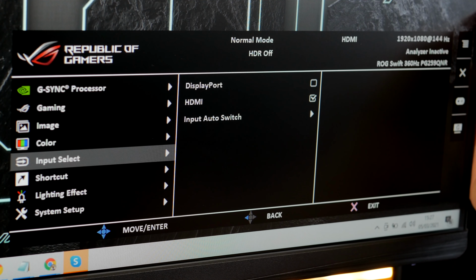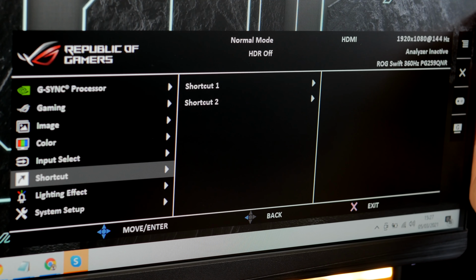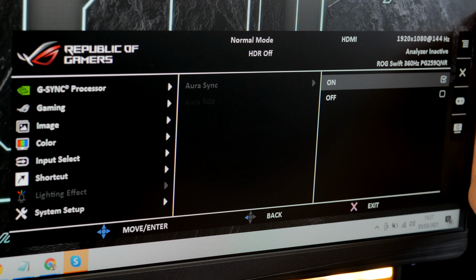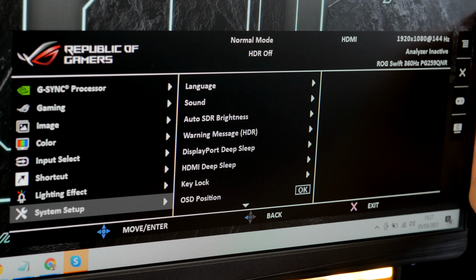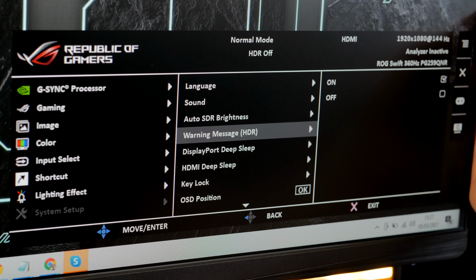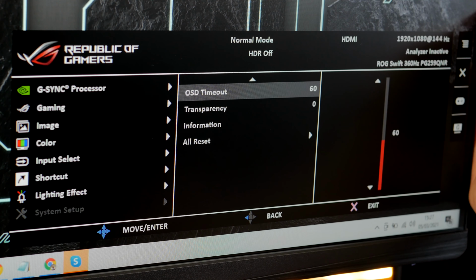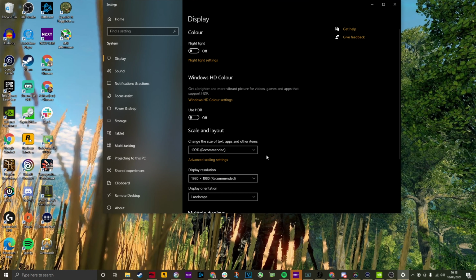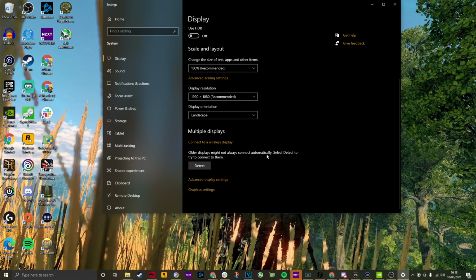Now, Nvidia has an interesting video demonstrating how this works, which compares 60Hz, 144Hz, and 360Hz screens, and I'll put a link to that in the description. But basically, the setup process for it is really straightforward. The first thing to do is to make sure that you have your screen set to the right refresh rate. So we want to make sure it's set to 360Hz within Windows.